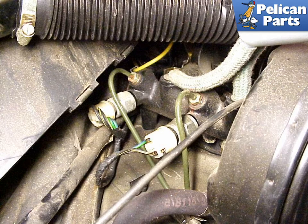Before you remove the master cylinder, make sure that you siphon off as much of the brake fluid as possible using a turkey baster or applicable tool. Disconnect the hoses that connect the master cylinder to the reservoir, and remember that you want to avoid spilling any brake fluid on your paint.